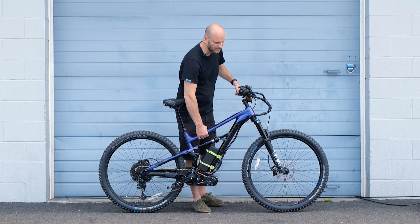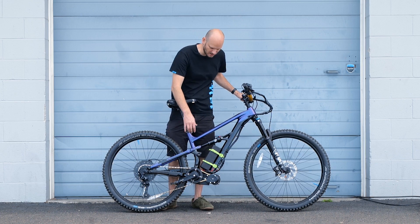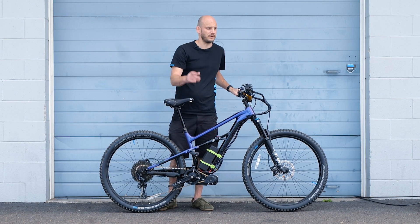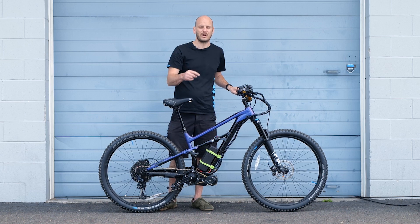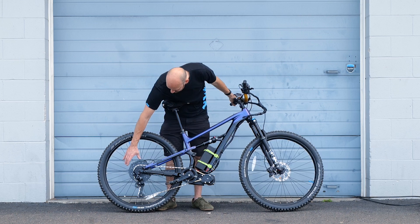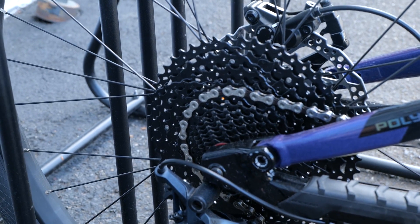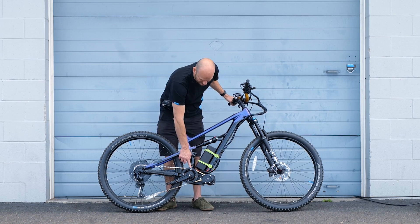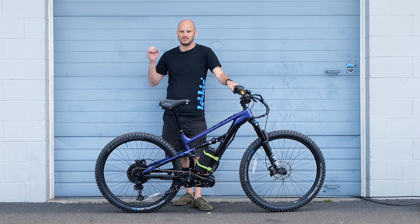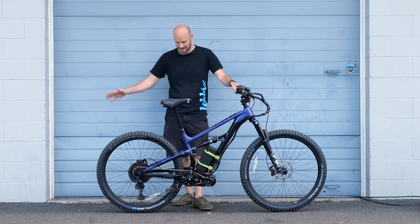This bike weighs probably 50 pounds, so you do the horsepower-to-weight ratio and it's like 5 pounds to every horsepower. But not only that, it's also how you gear it. This thing is geared for torque. We went with a small 32-tooth chain ring up front, and then there's this massive pancake granny gear in the back — that's a 51-tooth. So with a 51-tooth by 32 teeth by 6,400 watts, it means more torque and more power than anything can handle.